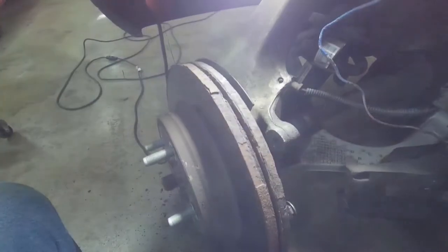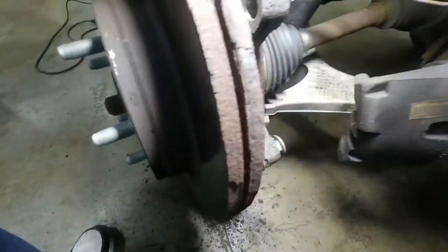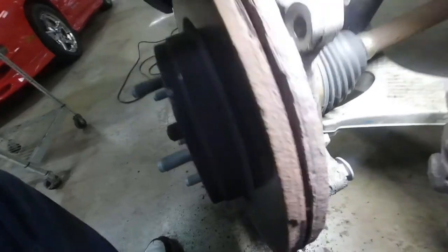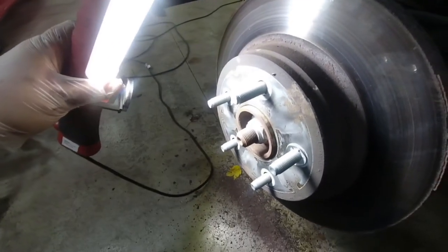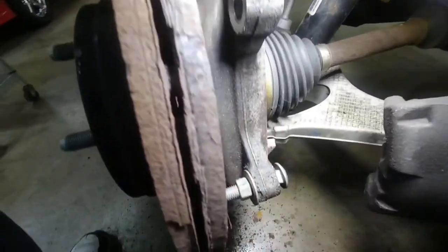You can do it on any vehicle — cars, whatever it's stuck on. If you don't want to use the hammer, never use a blowtorch. Just do a little setup like this and it'll break your rotor free for you. I've only ever had to do this on the trucks. The cars, that's usually never a problem — a couple of hits with a hammer will do it. But the trucks, it always seems they're rusted on and I have to use this trick to get them off.